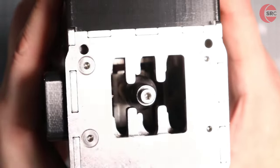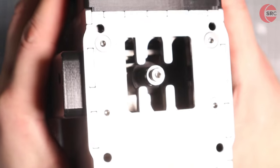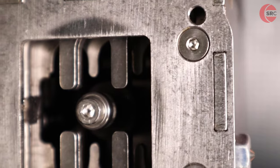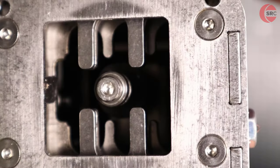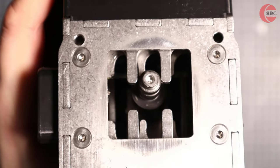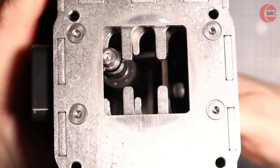There's a cutout in the underside of the enclosure, giving us a window into the working parts of how the mechanism functions. There are two gear gates, a large one positioned over the top of a smaller one that appears to be in an offset position and obstructing the channels of the larger gear gate. If I attempt to engage a gear, it's blocked by the smaller gate. This is how the active lockout works.